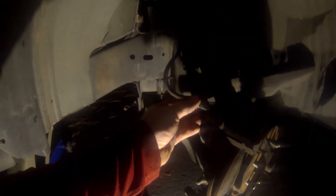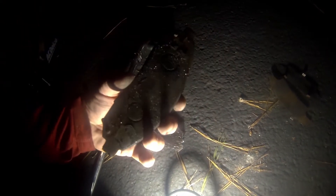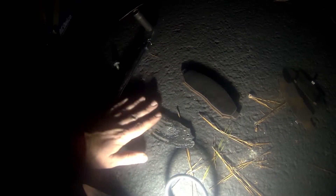Alright, I got the rotor off. It's just these two little 14 millimeter bolts right here at the pad for the main caliper, and then you'll need to compress these back. As you can see, this pad was completely gone — the inside one. Look at that — this is all very chewed up. It should be rough against your fingers if you rub hard against this. That's why it was very severely digging into the caliper right there.